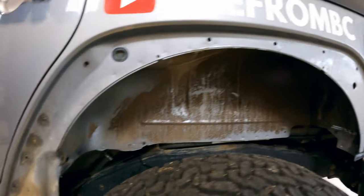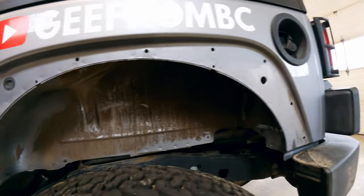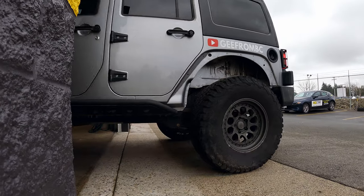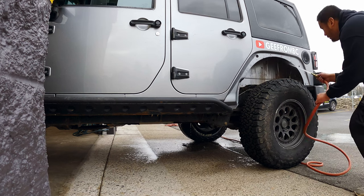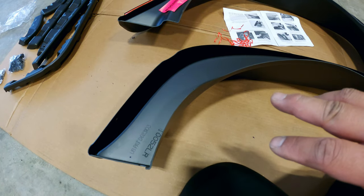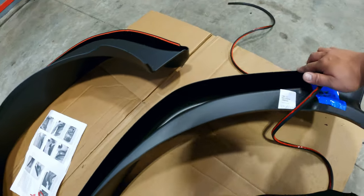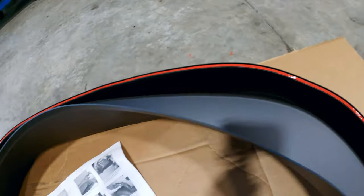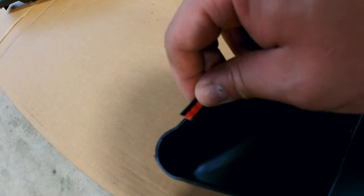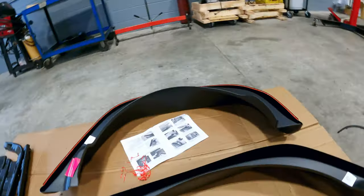All the clips are removed now. I think the next thing to do is clean out the gunky items. I'm waiting until the inner fender dries out first before I start working on it. For now I'm just going to put the weather stripping around the fender itself. Basically you try to clip this whole thing through here and just follow the lines throughout the whole fender, and then you're all set.